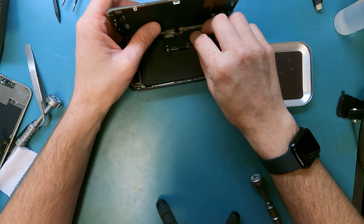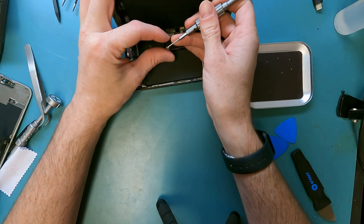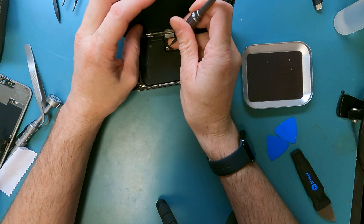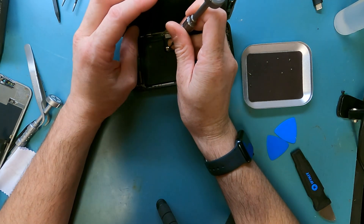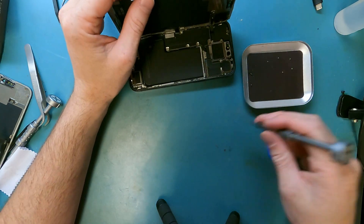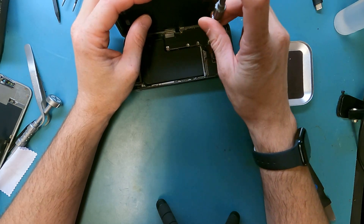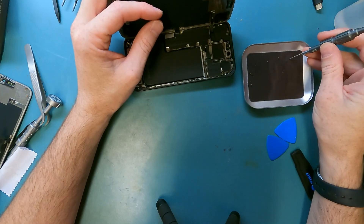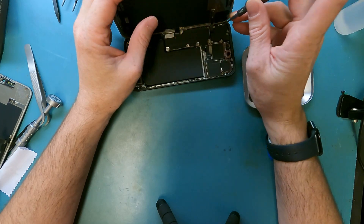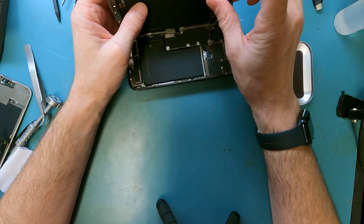After we get this on, we will screw it all down. I'll use some adhesive — I recommend making sure you use the pre-cut adhesive that comes with the screen. My screen didn't have some, so I had to grab some liquid adhesive and put it all around the edges, then clamp it afterwards. I'm not quite sure if the liquid adhesive makes it as water-resistant as the pre-cut adhesive. I'd like to put that to the test in another video, so please subscribe to watch for that. I don't have the vacuum sealing machine — it's a bit expensive — but we've already been trained that water doesn't belong in phones.